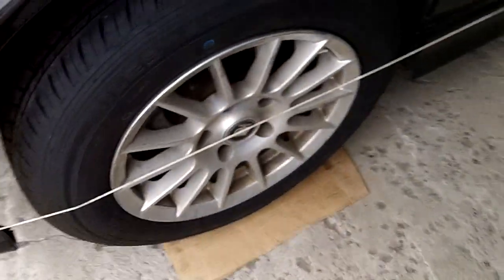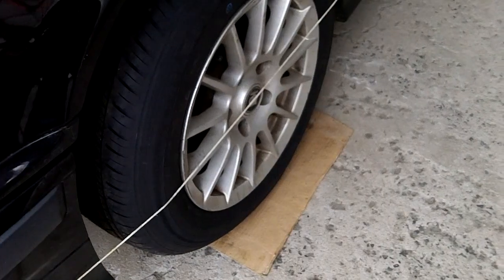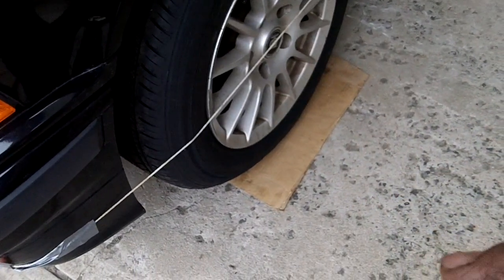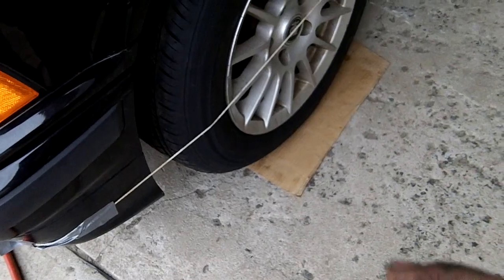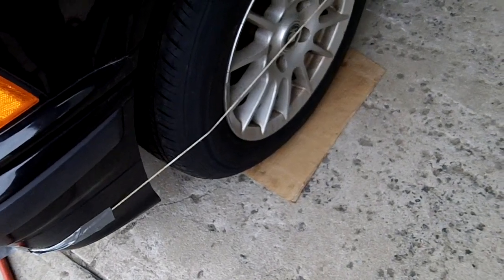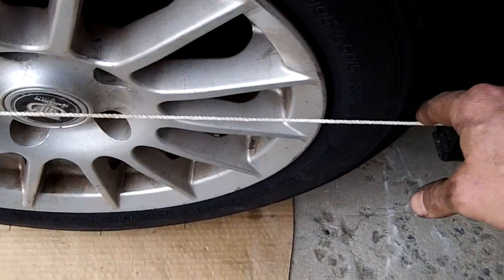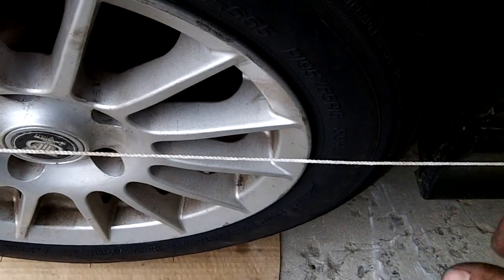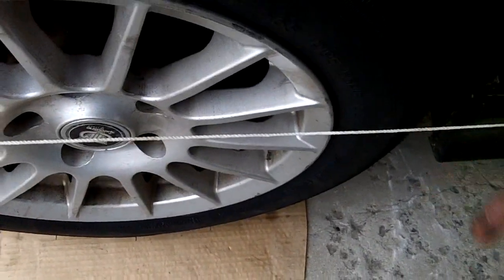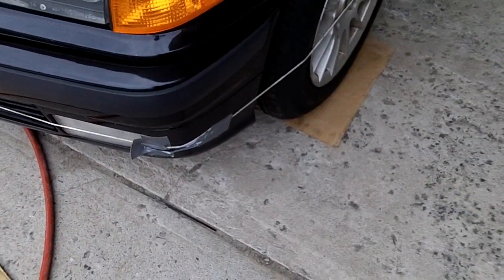I got it on a little piece of cardboard, mostly so the wheel turns a little easier because I'm going to twist the tie rod ends. I'm going to get a tape measure under there now and get a measurement. I want the front to be toed in about one-eighth of an inch, so the front measurement has to be an eighth of an inch smaller than the back measurement. It's not a science — I can't get directly halfway on the tire. With a tape measure, I'll do what I can. Once I figure out how much I've got to move, I'll try to get this evened out. This dimension here is my critical dimension. Remember on the other side I had about a quarter inch of slop, so I'll either take the other side in to tighten this up, or take this side out to get a little more slop there.